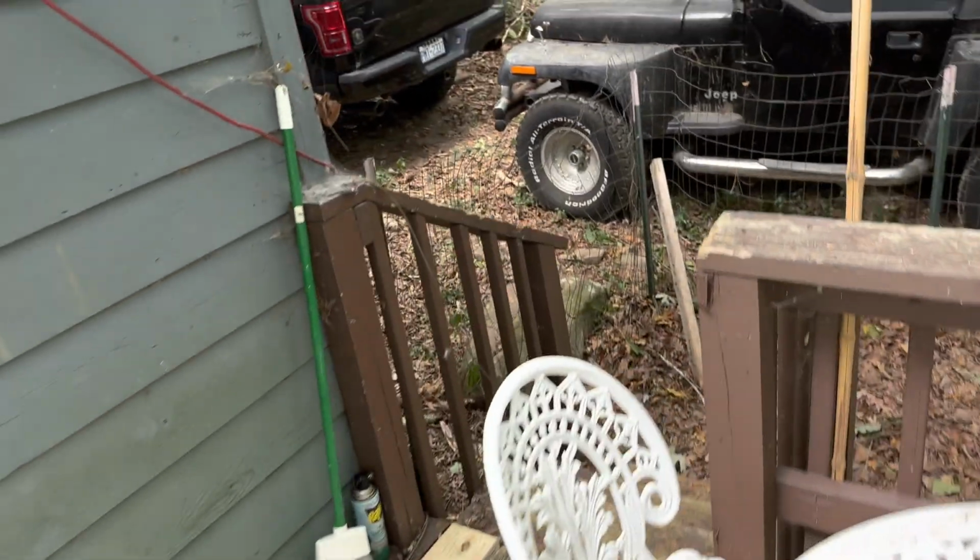All right, so I have to level my truck as much as I can. There are no level spots around here, so I might try to drive it up on some cinder blocks or something like that, just to get it as level as possible during the oil change. That is very important, so when you actually drain the oil, you don't have a bunch of old oil sitting in there that wasn't able to drain out because the engine wasn't level enough. And when you refill it and you're checking the dipstick to make sure there's enough oil in there, you want the engine as level as possible for checking the oil as well. So let me try to level the truck or find a level spot, and then I will take it from there.